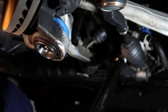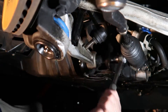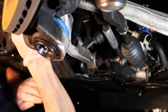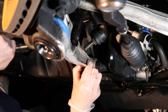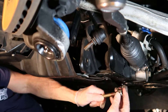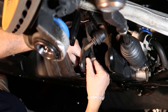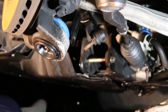Once the nut got loose, the bolt started to spin, so you'll probably need two ratchets to get this bolt off. I stuck one on the other side and was able to remove the nut. Once you get that nut off, my control arm just popped right off. Sometimes you will need a rubber mallet to break it loose from the lower ball joint — make sure the cone that sits on top of the lower ball joint stays on the ball joint. Mine luckily stayed on top of the ball joint, and now I'm just putting the bolt back in so I don't lose track of it.